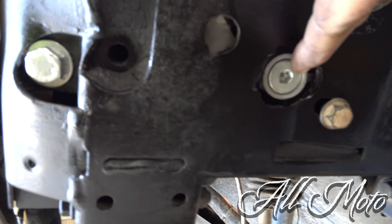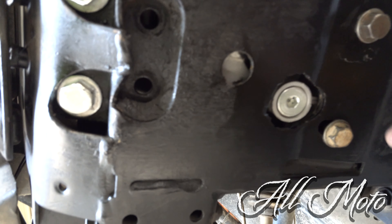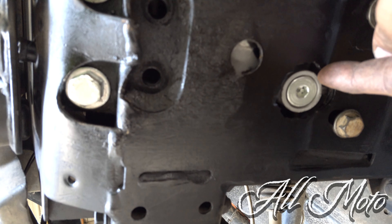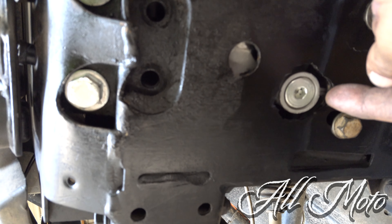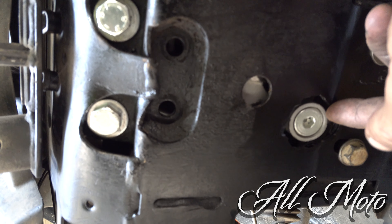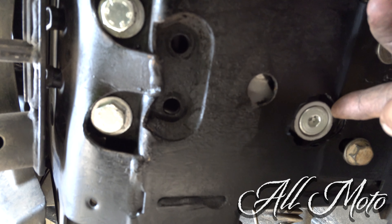I had a little bit of clearance issues. I don't know if a lot of people use the 5/8 spacer, but if I would have gone with the 5/8, it would have been super close right here at the drain plug. So I went ahead and cut a little bit more out for some clearance and went with the three-quarter. In my opinion it works great — three-quarter plate is a lot more common than 5/8 around here anyway.